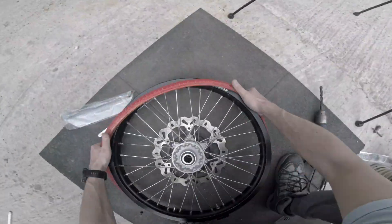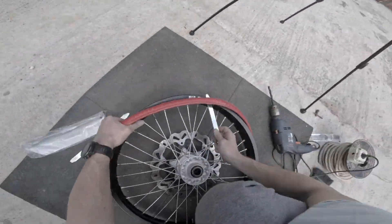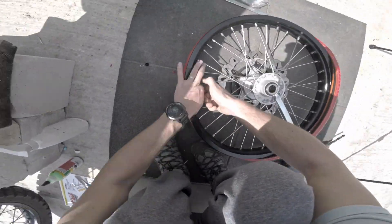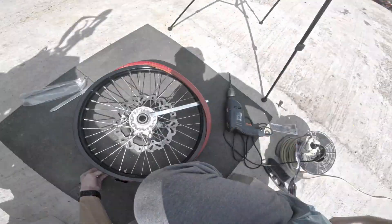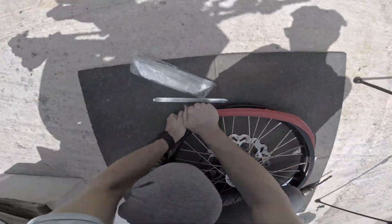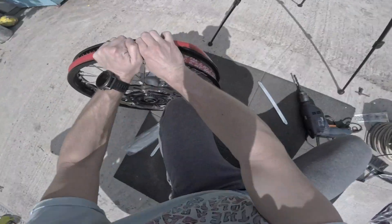You will use a tire iron to slide the tube in place, but in order to make it easy, you can remove the valve stem in order to let all the air out from the tube. Now you can learn from my mistake and make sure you remove the stem from the tube valve and not the tire chamber valve. You will see soon that because of this stupid mistake, things go south for some time.